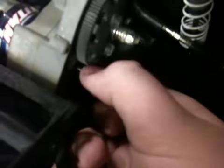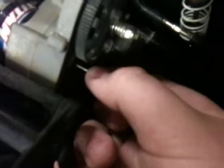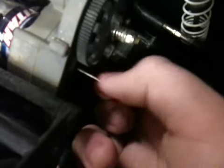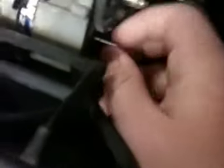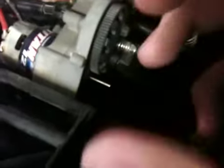That wiggling is what makes me think a motor bearing is blown. When you turn it you can feel it not turning around smoothly — it kind of catches and grinds. I'll go ahead and plug the battery in and let you hear it. It is a loud noise, so I'm just going to warn you.